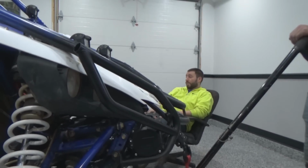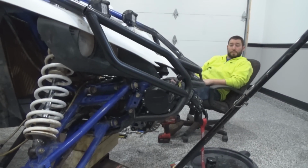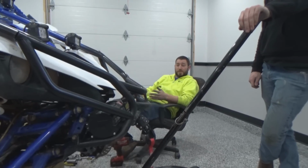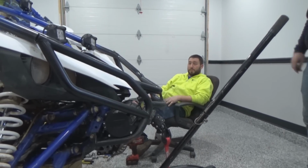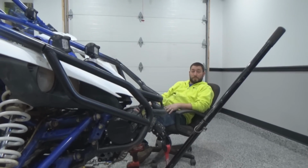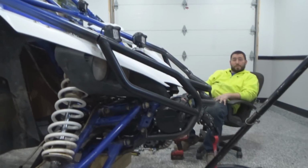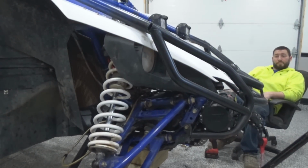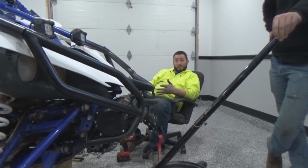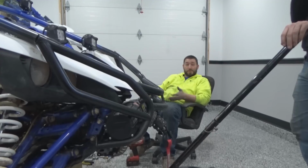In my opinion, if I was following our channel and thinking about buying portals, I would definitely wait and hold off, see if we can figure out the steering issue. It's not that it's hard to steer, there's just so much violent feedback. If you're trying to bump some ledge or do something, not even wild, it's not the same. When you bump up a ledge and it goes full droop, the way the geometry is with this setup, well, hopefully not this setup, but the other setup that comes in a kit, the tires pinch together and go wide, and that's what it's doing on the hills when the suspension's unloading and loading. So, just trying to share everything. Keep that in mind, watch the front tires of portal cars.